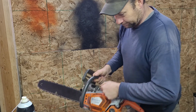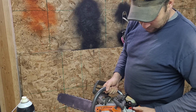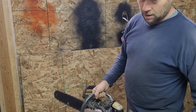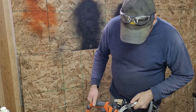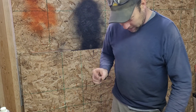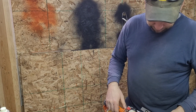It's an Auto-Tune carb. You think everything's good, it fires up, and then I'll show you something here. There's an obvious air leak — it's one I've been fighting a bit. The way the intake manifold works on these ones, it's pretty tricky to ensure you've actually got a good seal down there. There's just a plastic tab that hooks through an ear, and I think it was on the flywheel side. It's really hard to get that one to actually stay locked.